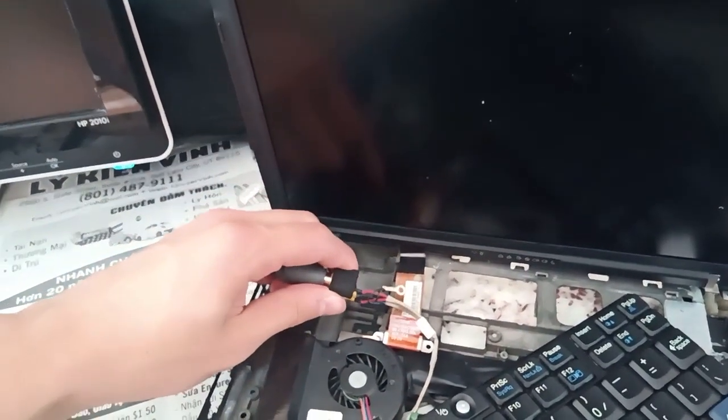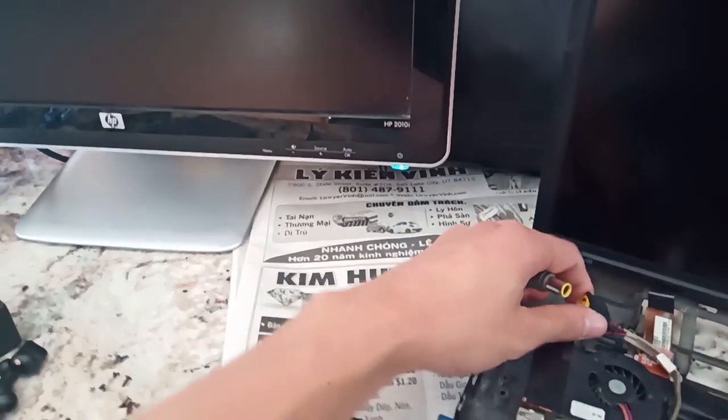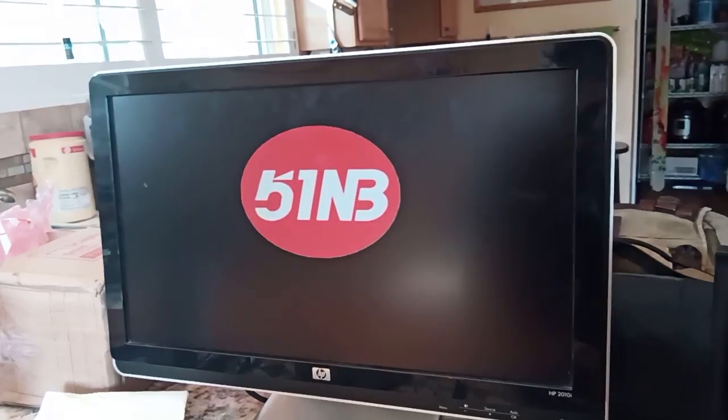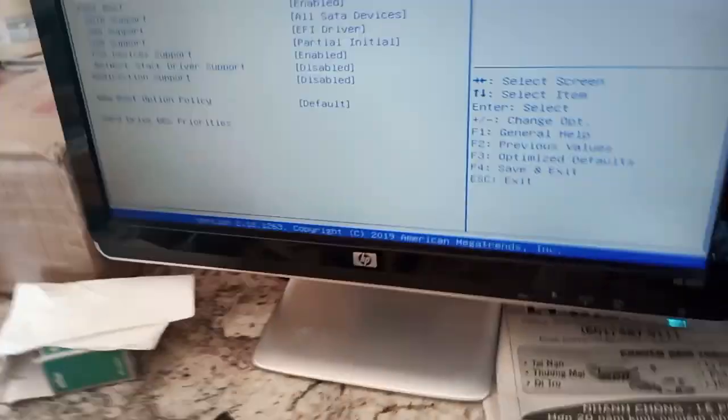Hello, sweet child. Okay, monitor should go inactive. Okay, turn you on. Let's get you into the BIOS. I believe on my X2100, the BIOS key is ESC for some reason, and not the ThinkPad button. Okay, fan stopped spinning. Yes. Okay. Man, that is one low quality image. Okay, it is ESC on this. And then we do detect the flash drive.